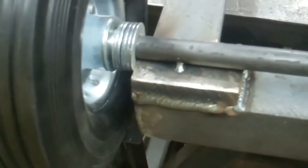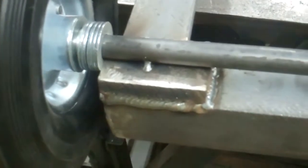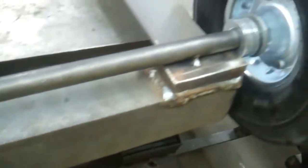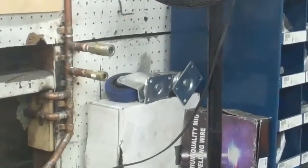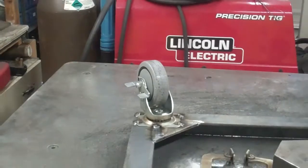What I had to do to make this come out right is space the axle down five-eighths of an inch. Originally I was going to use those other wheels over there, but they didn't have brakes on them, so I decided to go with these other ones, which are a little bit bigger.